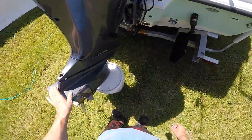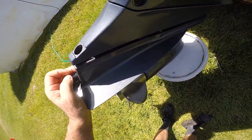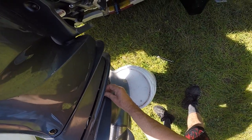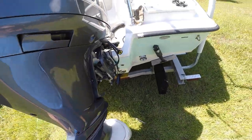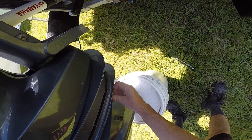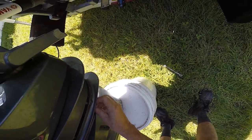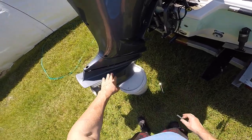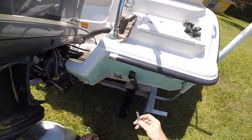I had to put something to hold the weight — I couldn't hold it anymore. When you get older these things aren't that easy to do. The shifting mechanism wasn't in place so I had to pull it back down again, align up the spline, and then got it in place. You've got to get the shifting mechanism and the engine spline done at the same time. It was really difficult. So now we're going to get all six bolts in, bring it up with the wrench and tighten everything up and we should be all set.